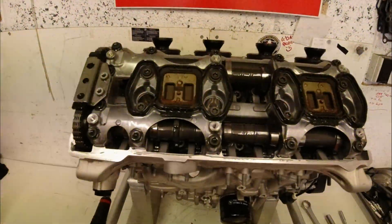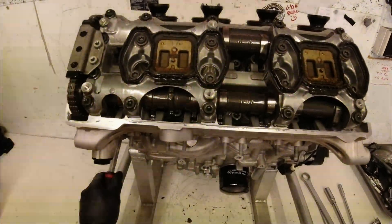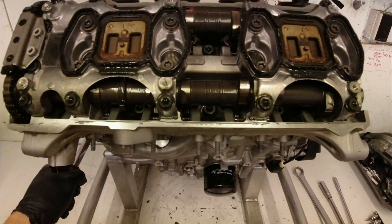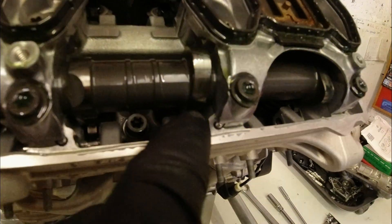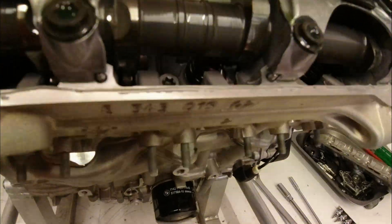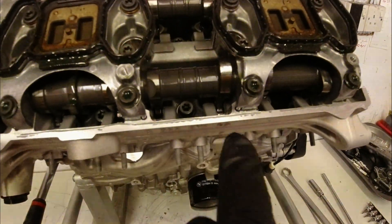What I can do now is swap the cam into my other hand. Obviously if I turn the engine over with this, I'm turning the crankshaft and the cams are turning. So for example, you can see this one — the lobe is at the top, which means the base circle will be at the bottom, down by this rocker arm, so we can put a feeler gauge in there now and measure the clearance.